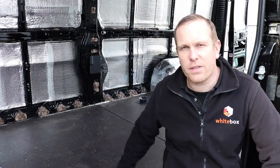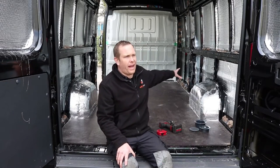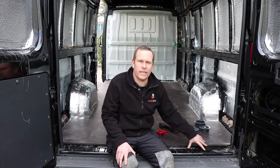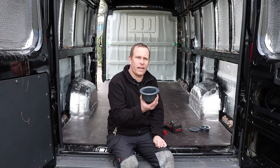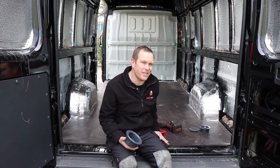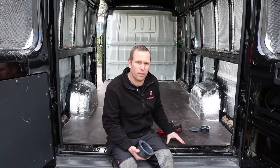Now we just need to find some space to fit the floor vents in the van, having a look underneath to make sure we're not going to foul any fuel tanks, tyres or anything else like that, and get in the right position in correspondence to the roof vents because they have to go diagonally opposite each other. I'm going to fit one of the vents to the rear of the van — this is going to have four vents in total. I need to make sure it's not going to foul underneath because this piece is going to protrude from the bottom of the van. There's a tyre here, and also there's a fuel tank up there — you do not want to be drilling into a tyre or a fuel tank.